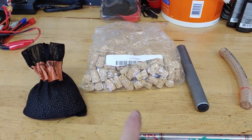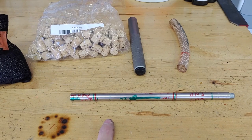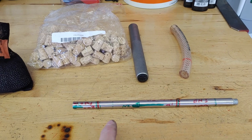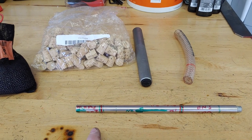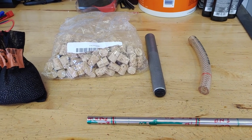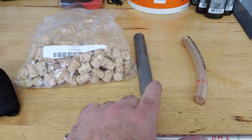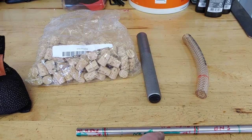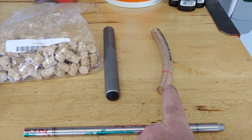I take a cork and, using this rod that I've measured, I shove the first cork in the end of the handlebar until it hits where the bar turns the radius — where it first starts to bend. Then I measure the distance between the end of that cork, a second cork, and the bar insert to see how much room is left over and calculate the space. Then I use an old bar, fill it with birdshot until I get the right amount of volume for that diameter space, pour it out into this tube, and mark the tube — that way I know exactly how much needs to go in.